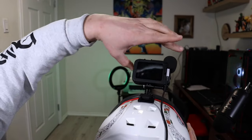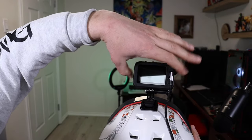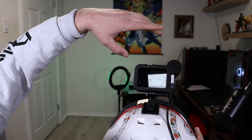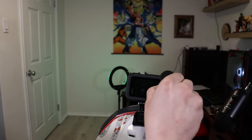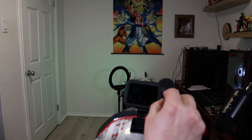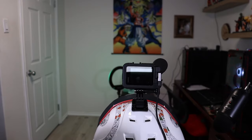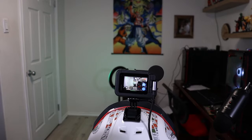That downgrade will enable you to run a power bank without a battery without any issues. There is one small thing to know. With it plugged into the power bank, press the button to turn the Hero 10 on. If it doesn't come on, just unplug it. If you had the battery in there this causes huge issues and you'd have to take everything apart. So just plug it back in and you'll see that red light flash once — then press the button and the camera should turn right on.